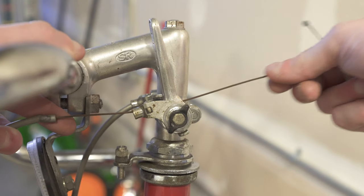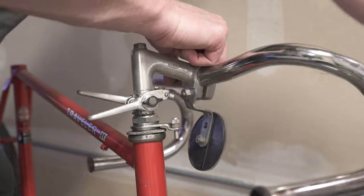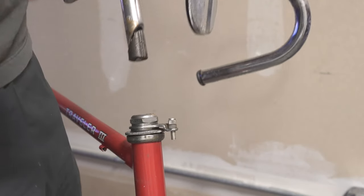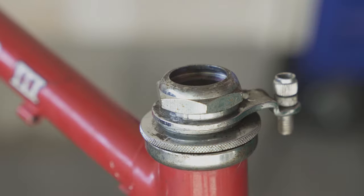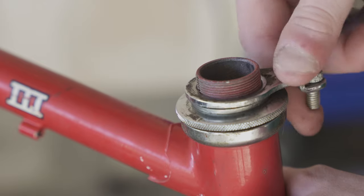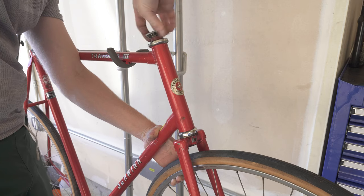I'm really going to try to keep and restore as many original parts as possible. Brake cables and shift housing, in my opinion, are consumable parts — we will be replacing those. I got really lucky with this quill stem — there's a little bit of corrosion on it, but those can really seize into the fork, so I was lucky it came off pretty easily. We've also got the brake cable holder, the keyed washer, so as you tighten everything the bearing races don't compress too much — and that's the bearing race right there.